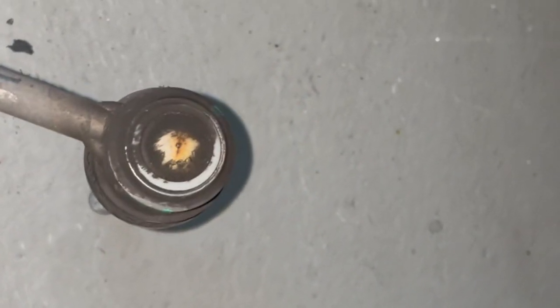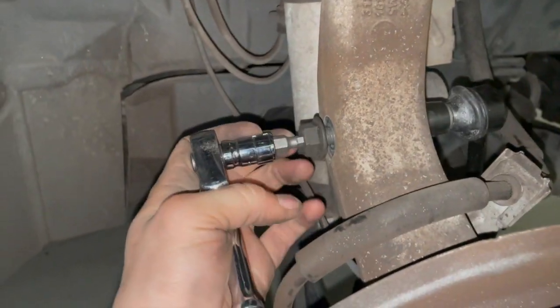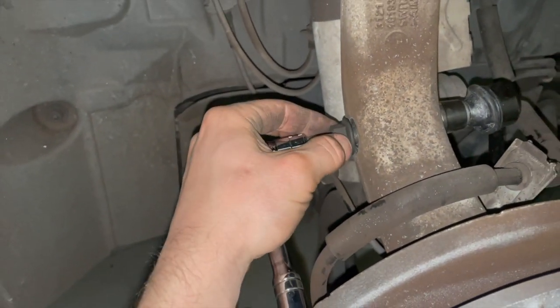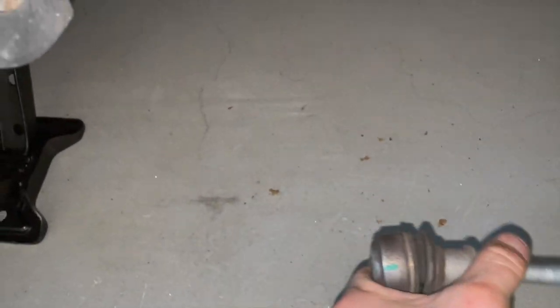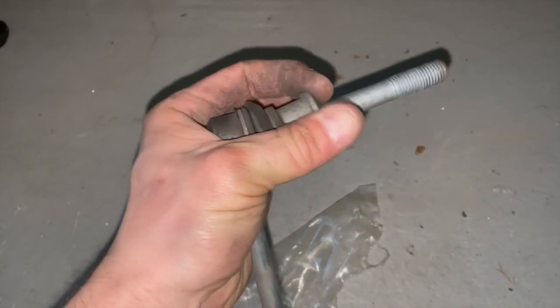It's the same part number. It's not a hard replacement to do, so I will continue on with the reinstall — always good to make sure it's nice and clean on both. Something to note on the new stabilizer link: this was actually a number six hex, slight difference, but the rest of the link looks pretty much the same. On the ones I took out, they were really, really easy to move — very loose on both ends, so obviously they were on the way out. Whereas the new one is quite stiff, so there's a distinct difference between the two.